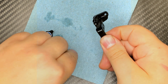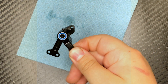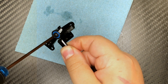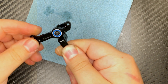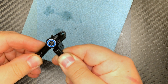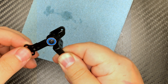I'll start with the 0.1 shim and see if the assembly still moves freely. Crank on this — you can always use Loctite on this as well if you want. The bell crank is super free and very minimal rock back and forth, that's probably pretty good. You can always try a thicker shim and see if it's binding or not.